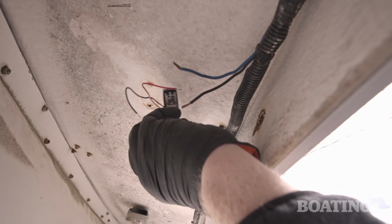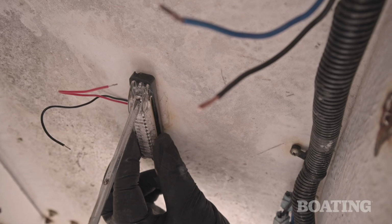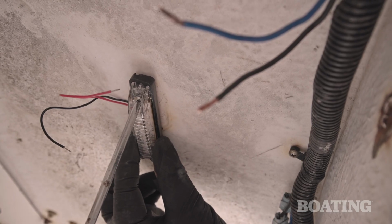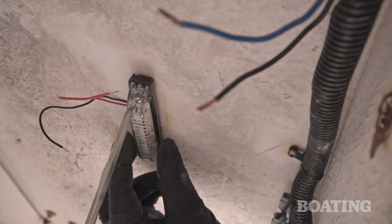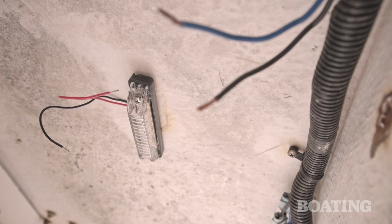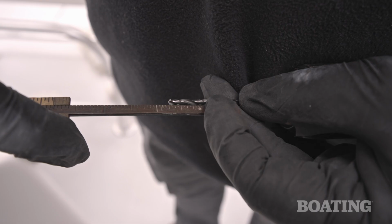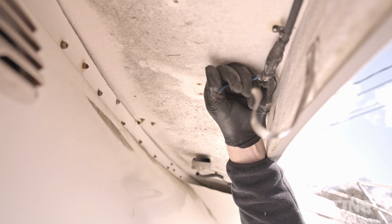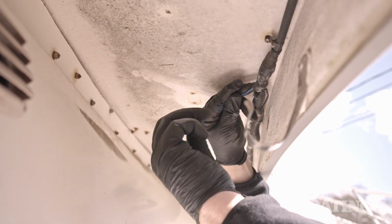This installation calls for surface mount. If the light you are replacing is flush mounted, make sure it will fit in the hole. This is also a good reason to meter the wire, since you can't visually inspect it like you can a surface mount fixture. Check the fit and drill any holes before wiring the fixture. It's easier to make wire connections this way since you'll know exactly where they will end up.